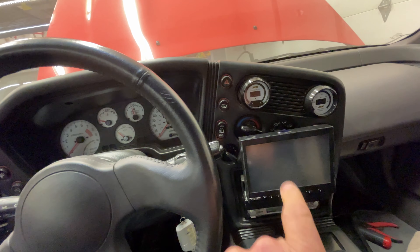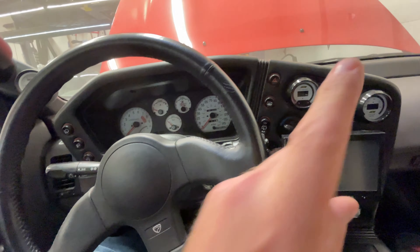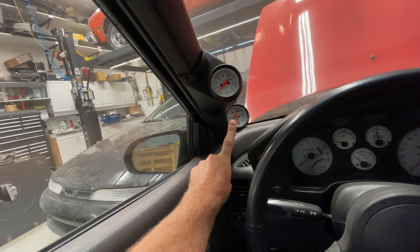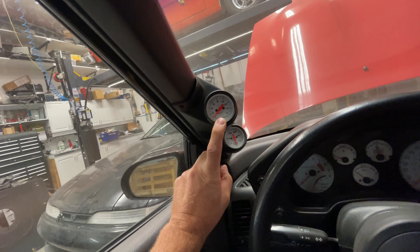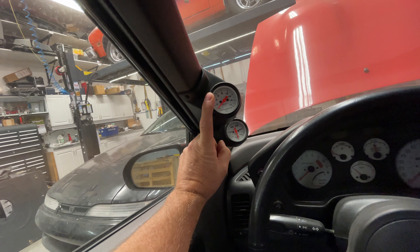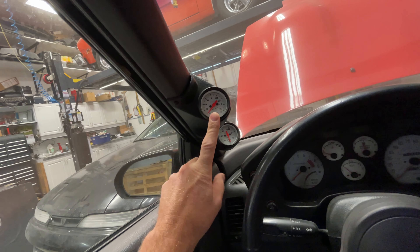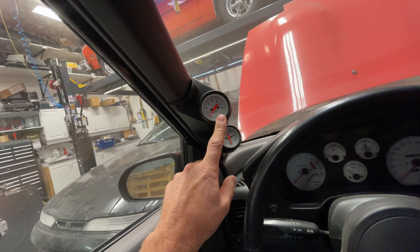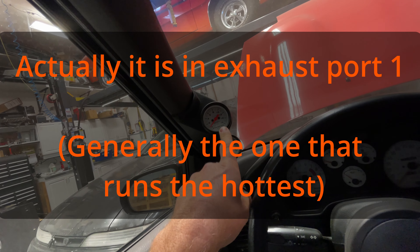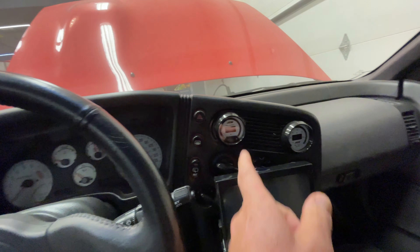This is the setup. There's a secret you're going to know about that I had back in the day — not pretty common now, but back then this was kind of state-of-the-art. For gauges, I had fuel pressure — I actually logged that, tapped it into DSM-Link or ECM-Link. I had an EGT gauge, which back in the day, before we had actual wideband air-fuel ratio O2 sensors, we really relied on this. I still rely on it somewhat — I like to know what's going on with my exhaust heat. Ideally you'd have one in each exhaust port, but I just put it in the collector and the manifold up front. And there are a couple other gauges here — I'll show you part of the problem. I'm going to just light it up here. You can see it doesn't light up — these lit up. That's part of the problem I've got to work on today.